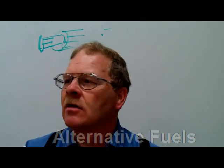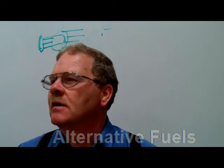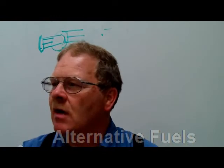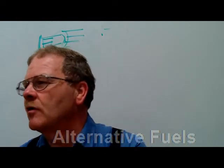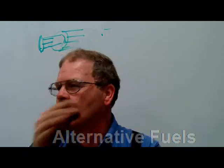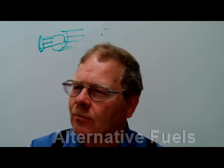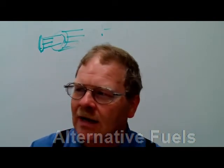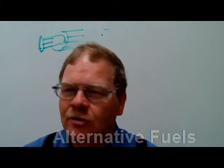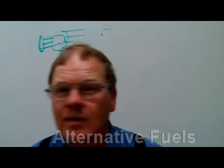Because every molecule of oxygen wants to get married. You got carbon dioxide, right? You got two molecules of oxygen to one molecule of carbon. That's as good as you're going to get, and that's what you get at 14.7:1. Now, if you've got a richer mixture, like 12:1, there's not enough oxygen for every carbon molecule to get married to two. So some of them will just be married to one. Some of them will be married to none.